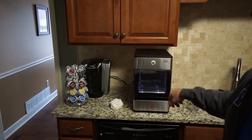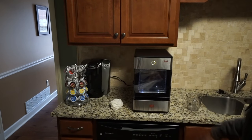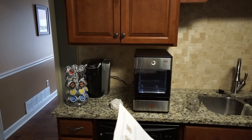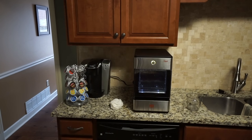I flipped the switch in the back to cleaning. It shows bright, dim, bright. As the Opal rinses, the yellow light will spin and you'll hear water circulating — apparently it's circulating now. In a few minutes it'll stop running, the yellow light will stop spinning and start pulsing, one portion will look brighter, and then you drain the water by unhooking the tubes and placing them in a sink or bucket.